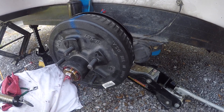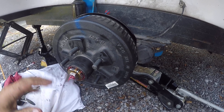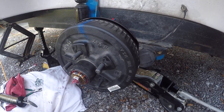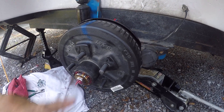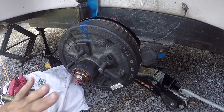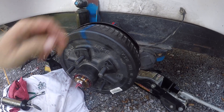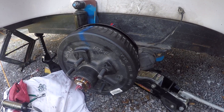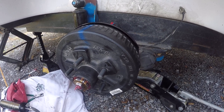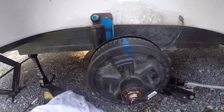At this point they've sent me new lug nuts. All I have to do now is put my dust cap on, put my tire back on, put the strap around this, and that's the job done. This is an 8247 if you're ready to order one. I bought original Dexter — everything original Dexter — and I did upgrade these to never-adjust brakes this time. Hopefully this is helpful. My final video should complete the job.